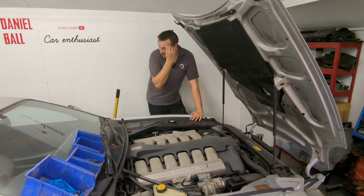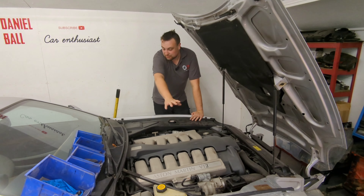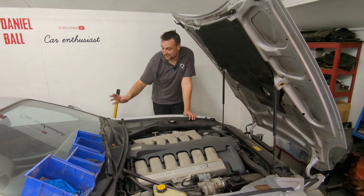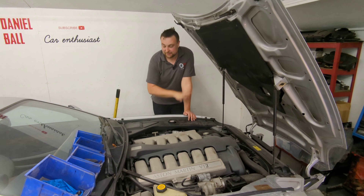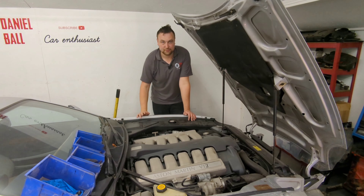The next job is to try and get the bonnet to fit a little bit better. I've decided not to worry too much about that wing — there's a little bit of crack at this end but the rest is okay. I know the bonnet is too far back because it's catching the scuttle cover slightly. So I figured if I try and get the bonnet lined up with this side, not worrying about the headlights, then fit the wing on the other side, and then I'll try and make the headlights fit — they've got quite a lot of adjustment, as has everything else.